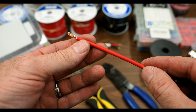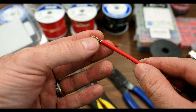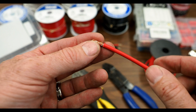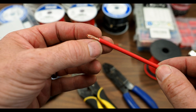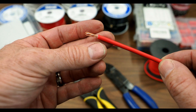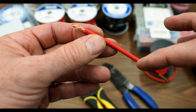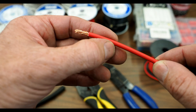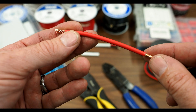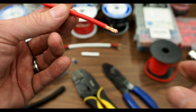The main problem with this particular wire is when you put it in wet environments. So if this is going to be on a boat, underneath of a vehicle, or in the engine bay where it's getting wet, over time road salts and water will corrode these copper wires and you'll start getting intermittent electrical problems. A lot of times you'll cut this off, strip it back to put another connector on it, and find that corrosion has traveled down inside the jacket — sometimes quite far. So you end up cutting and chasing that corrosion back until you find a clean piece. Not ideal for wet environments, but pretty common.